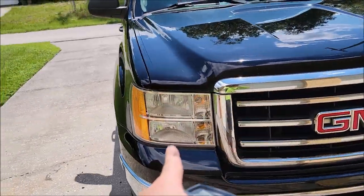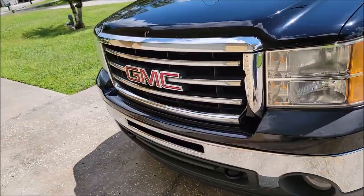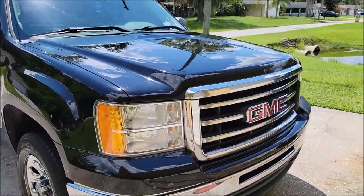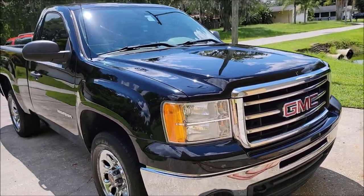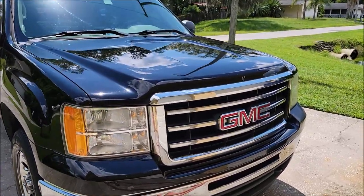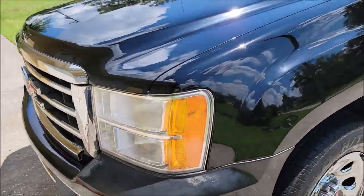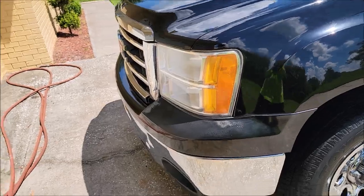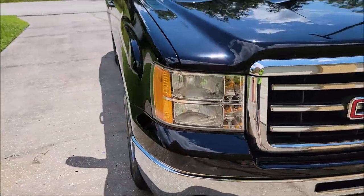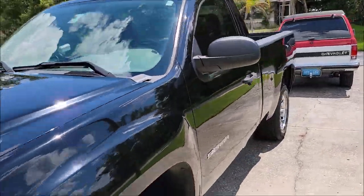I did cut the headlights a little bit. I had one 500 grit Mirka disc, a 3-inch deal in my bag. I didn't bring all my sanding stuff, but I found one 500 grit disc that I had used a lot, so it wasn't a full 500 grit of aggressiveness. But I buzzed the surface off and then polished those headlights as well, so they're a lot nicer than they were. The hood was all kinds of oxidized. It looks awesome now. Whole truck looks great.